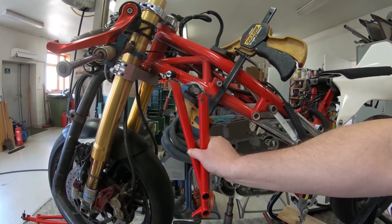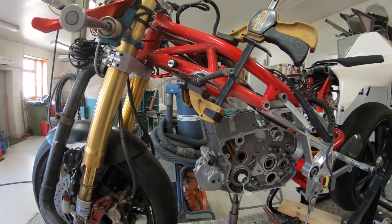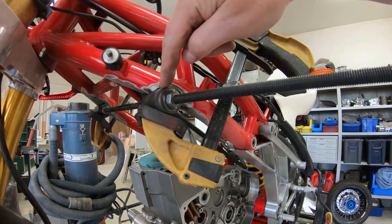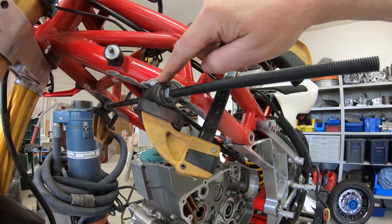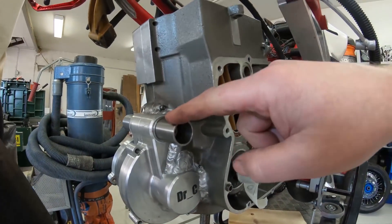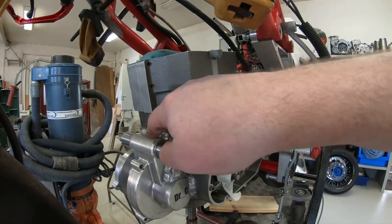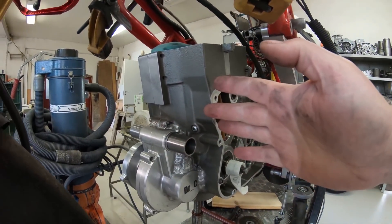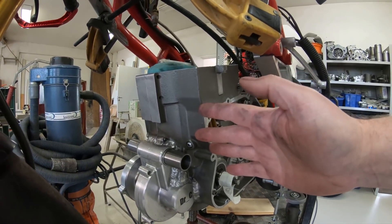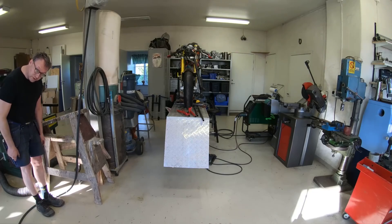The original engine mounts were placed like this, so I had to take them away to make room for new ideas. This is based on putting a kind of attachment here against the frame, then there will be a fork and down with a tube that will be welded on this bushing here. It's rubberized inside, so that gives the engine the possibility of jumping up and down maybe one or two tenths of a millimeter — that's a big stress reliever for the rest of the frame.